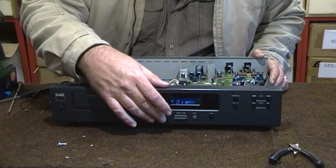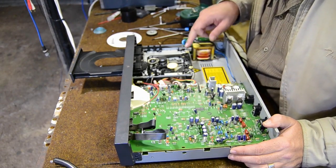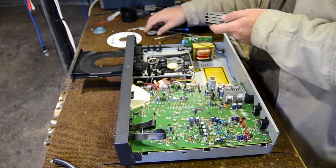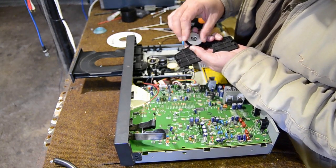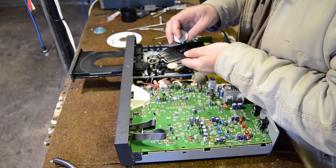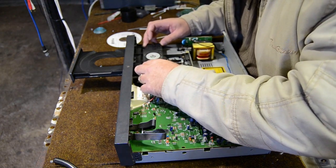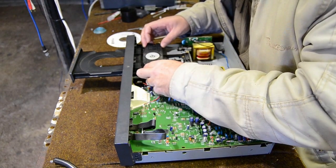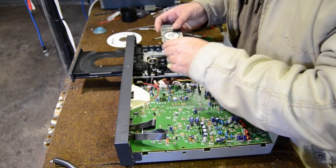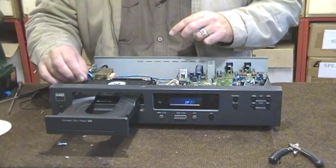Once you're happy that the system works 100%, take the CD out and reassemble the inner cover — it just clips together like that. This goes that way around, clips into there, and it's got little prongs that hold it in position. Note that this particular piece can only fit one way around — if your spindle motor doesn't line up it's not going to work.